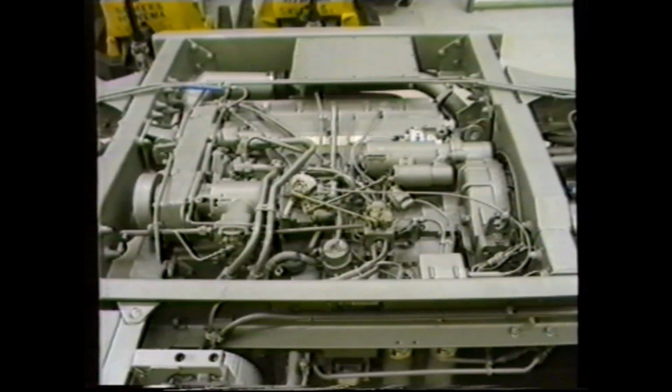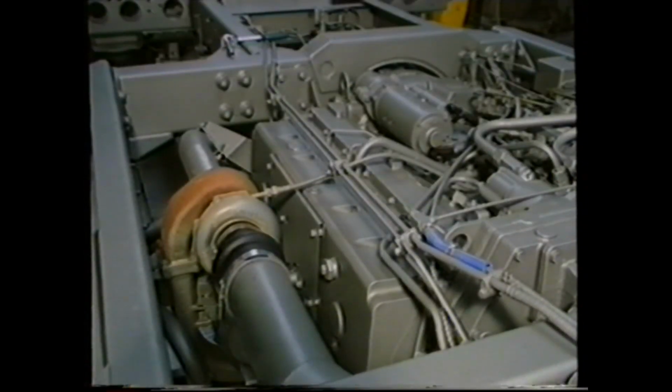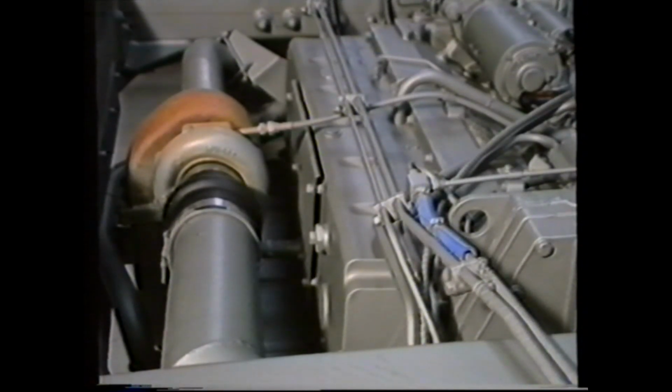On horizontal applications, because the fuel level in the tank can be higher than the engine, a non-return valve is fitted in the return line to stop the fuel siphoning into the engine after shutdown. When working correctly, it requires a pressure of 0.3 pounds per square inch to lift the valve. As part of the checks, make sure that the valve is free and not restricting the return. Although not part of this fault routine, it should be noted in this area that if the valve fails to seat after engine shutdown, the fuel from the tanks, if high enough, will flood one cylinder via the return line, because one injector will be in the fuel cycle. It will cause, in extreme cases, a hydraulic lock when attempting to start the engine.